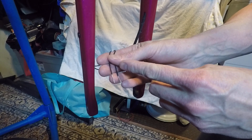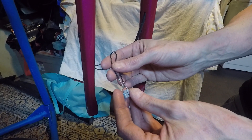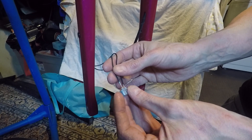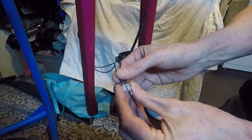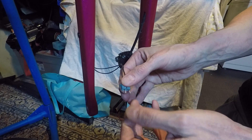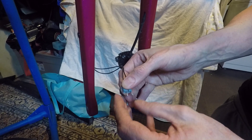You've got your two leads that come from your headlight. You pop one each through the separate holes, just like that — they'll pop through. You need to strip the wires to approximately 16mm as per the Shimano instructions.